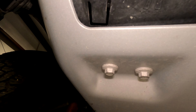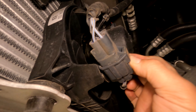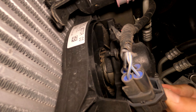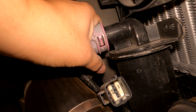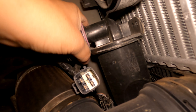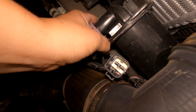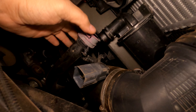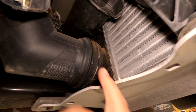Take those two out, squeeze right here and unplug this connector to the fans. For the blow-off valve part, you're gonna rotate it — if you're looking at it from the front, rotate it clockwise, towards the center of the vehicle, then just wiggle it off. Boom, blow-off valve tube is disconnected.